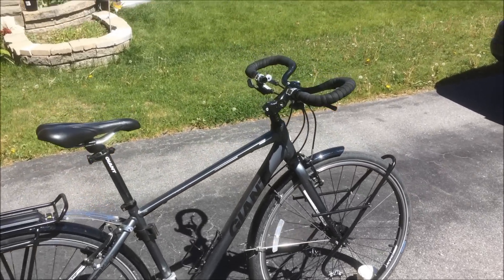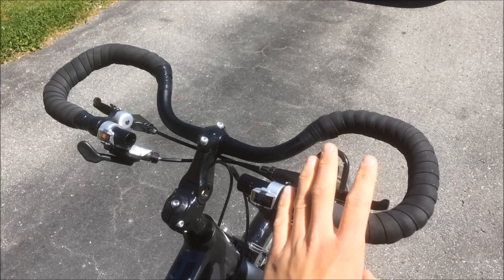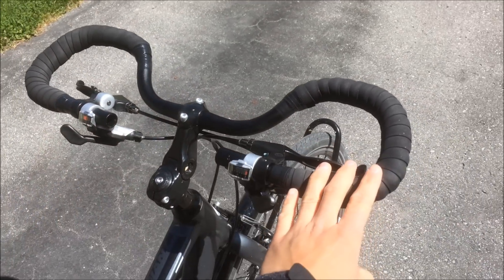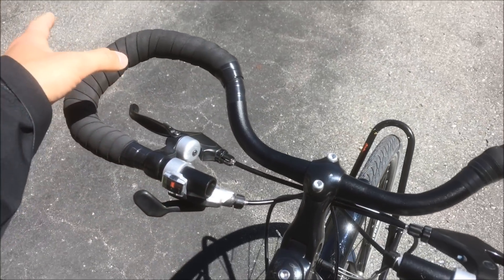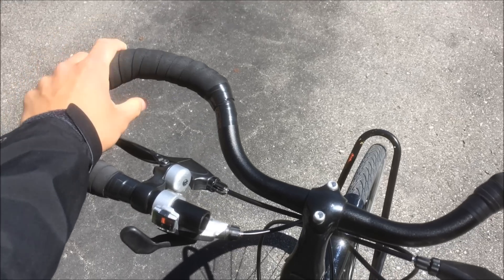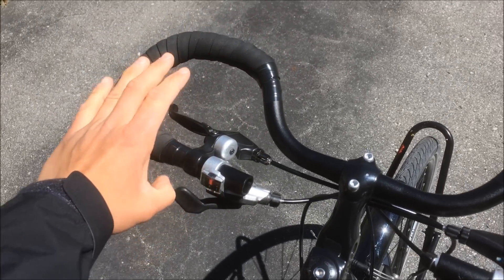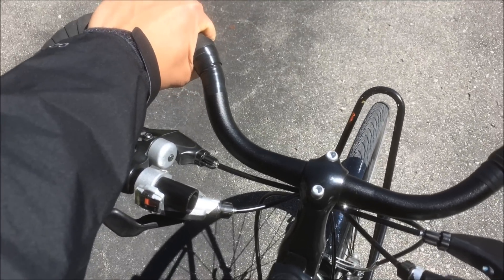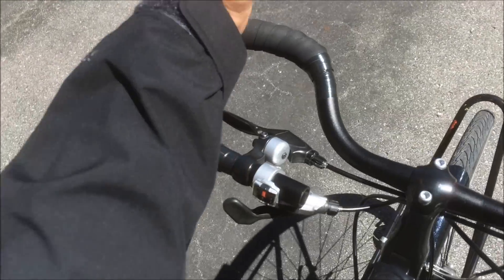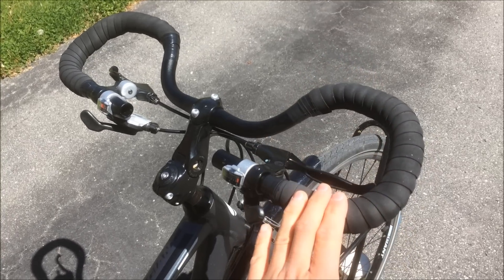The first and most major change I made to the bike was putting on these butterfly-style handlebars. I've had about a month to test them out and I'm really liking them. They give you an equivalent position to the previous flat bars out here on the side, plus a number of positions in between — a bit more upright back here, more stretched out over here, and you can also rest your forearms on the bars to get into a pretty good aero tuck position.